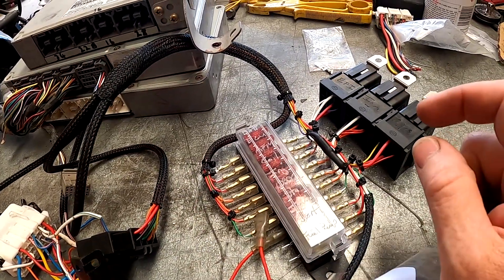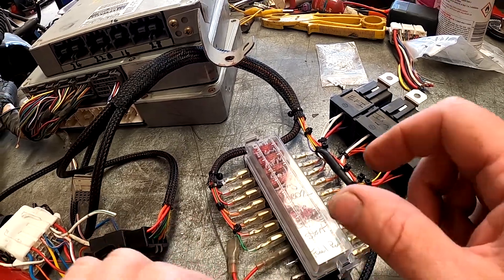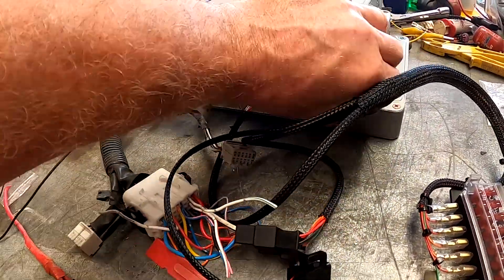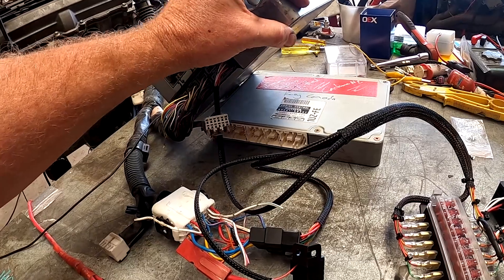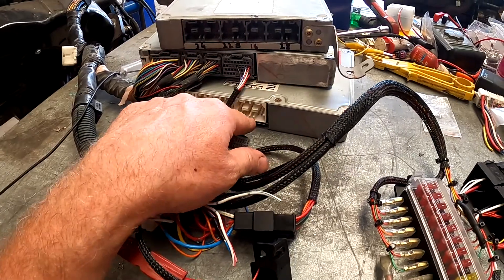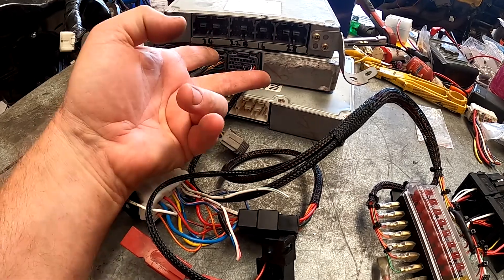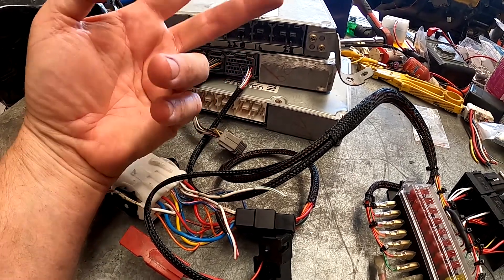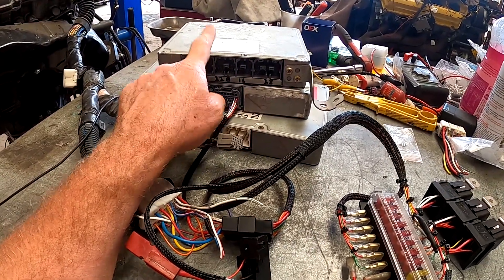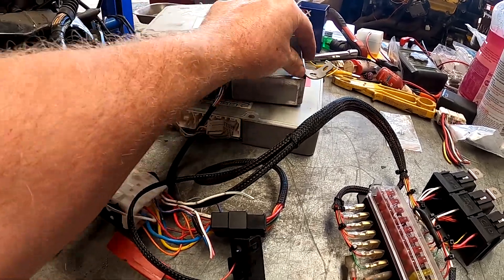Engine loom's fitted, I'm going to pop the fuel pump supply on here. I went to my cupboard and got a few ECUs. I got that one — so that is a US domestic market UCF20 with the white plug, but I'm using a JDM loom so the igniter wires, the IGT wires, are around the wrong way. That's a JDM Crown 151 Crown. I thought I would go with that OBD2 US domestic market ECU.